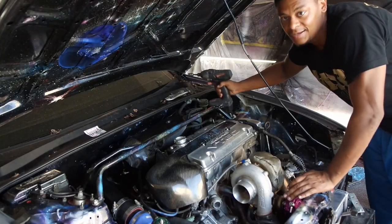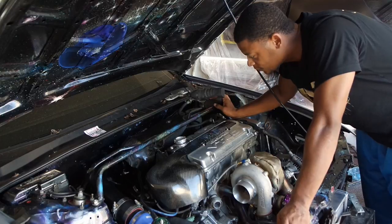Before we get started, I want to say that if you guys need to do your timing belt and water pump, it's good to do everything all at once. If you're going to do the work to get to the timing belt, you might as well do the water pump and vice versa. I'm going to put a link to the kit I got in the description below — it's all OEM spec. The only difference in my kit is I replaced the hydraulic tensioner with the manual adjustable tensioner. Save yourself some time and money, just click that link — whether you do it yourself or take it to a mechanic.